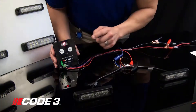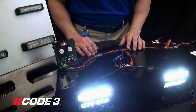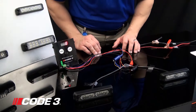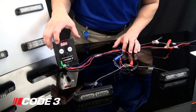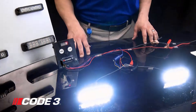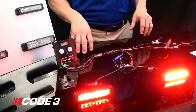It is going to go through the flash patterns and line up until it gets to flash pattern select 4. Once it is done, it will stop flashing. Once it is finished, to verify your flash pattern, go ahead and hit the demo button. Flash pattern 4 is a 75 flash per minute single flash pattern alternating flash colors. The demo button also runs for about 15 seconds.